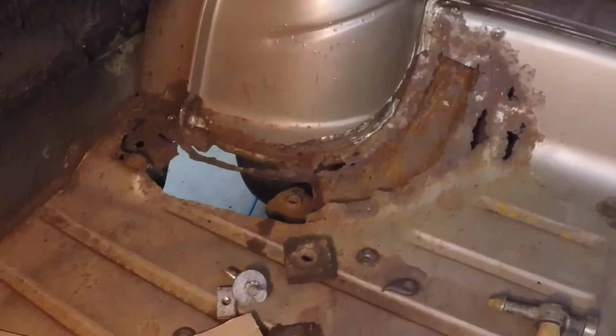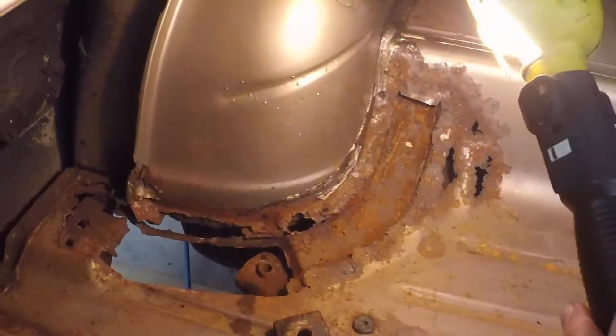All on this side of the trunk — completely solid, trunk latch, jacking instructions. You can see it's all really a solid car. Other than where that stuff must have collected in there — that's just rotted out exactly where that brace was. I don't know if there was a water leak. These sometimes have little rubber drip hoses from the trunk channel down through the body and they rot. Or sometimes the rear window — so the rear window has a molding that can drain.